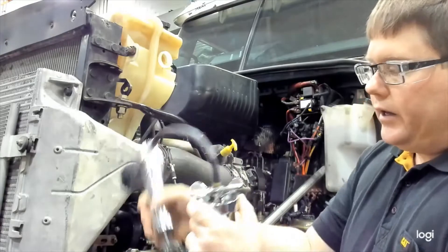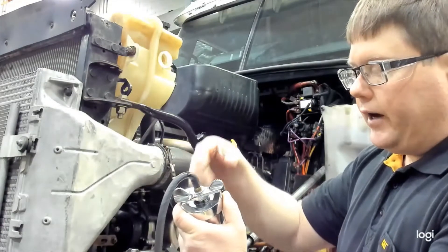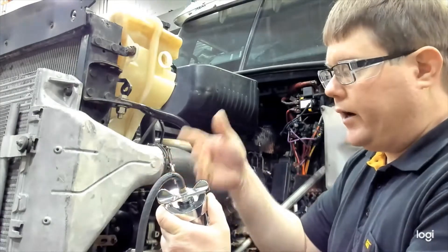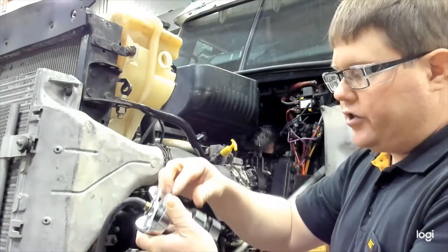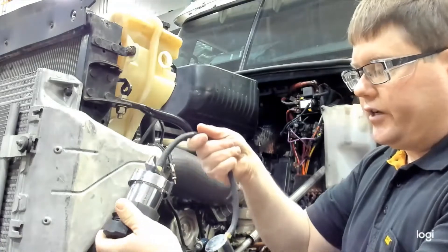What is critical are these ears across the top of the tool — this is a pressure relief. They tell you to have them parallel or in a raised position when you install it, but in order to pressure test, they need to be turned down so that spring pressure seats the seal to allow us to test the cap.